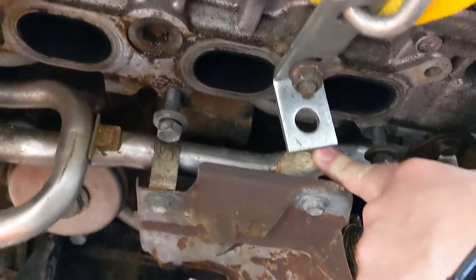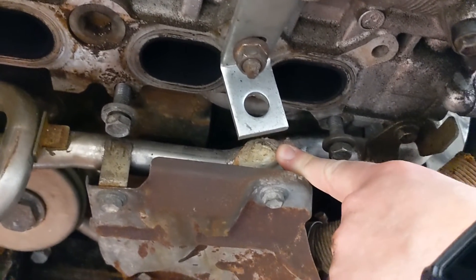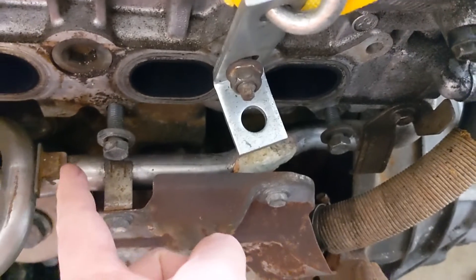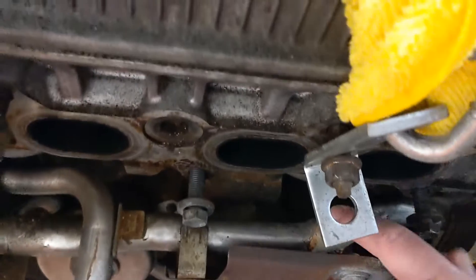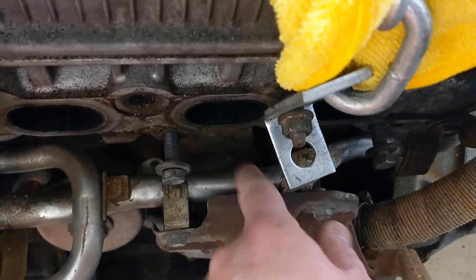When it leaks — when this cracks — there are a couple of things you can do. You can weld the crack shut, though that can be kind of hard. You can try using putty and paste like I did. Some people will actually cut it over here and over here, then run a silicone hose or a heater hose along here, and use a T-fitting for the oil cooler or oil warmer. What I'm probably going to do, because mine's leaking over here near the oil warmer fitting, is just cut it back here and put a plug on it.